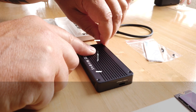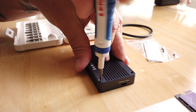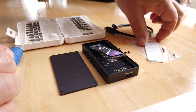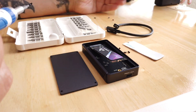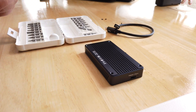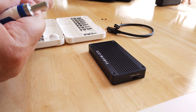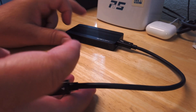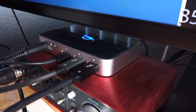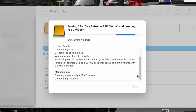How do you install this thing? It's got four machine screws in the corners. You unscrew those, open up the back case, open up your SSD drive, put it in and snap it in place. The SSD drive is held down by another screw, which I really like. Then you put the heatsink tape on top of the SSD, put the back case on, and screw down the screws. That's it. Plug in your Thunderbolt 4 or USB 4 compatible cable into your computer or USB-C hub, and you're ready to go after you format the drive.